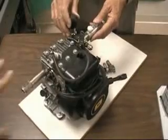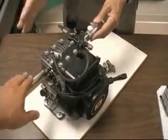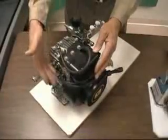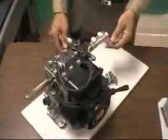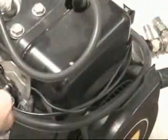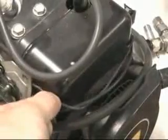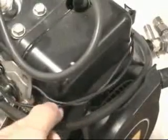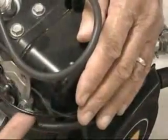Under $25 to convert this engine, and get more power than before — and be able to run a fuel that you can make yourself. To arrest vibration, I've just run a longer length of this springy stainless steel. This is the intake tube carrying the hydrogen, and this other wire is the kill ignition. The tube runs all the way over to where I do the valving.